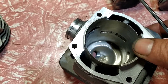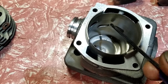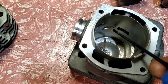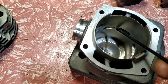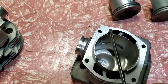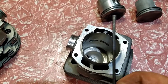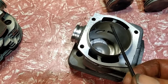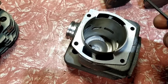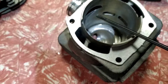I'm not exactly too worried, but I am cautious. The ring is supported by this post, so it'll come down at end of the stroke — bottom dead center — so it's not moving. There's no real centrifugal force throwing it. Most of the time the piston's going up and down but the forces are going sideways because the crankshaft is spinning. I've put the rings in the piston and tried by hand — nothing catches. Gone by the original piston, the pin's actually in the center basically. So I don't think I'll have a problem.